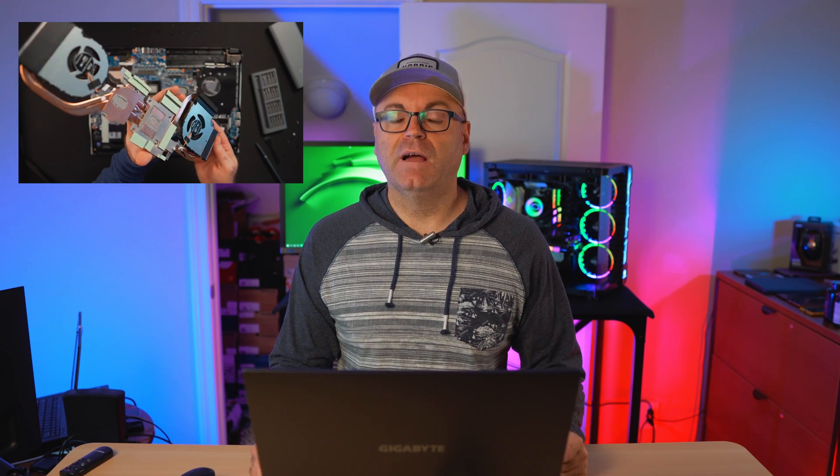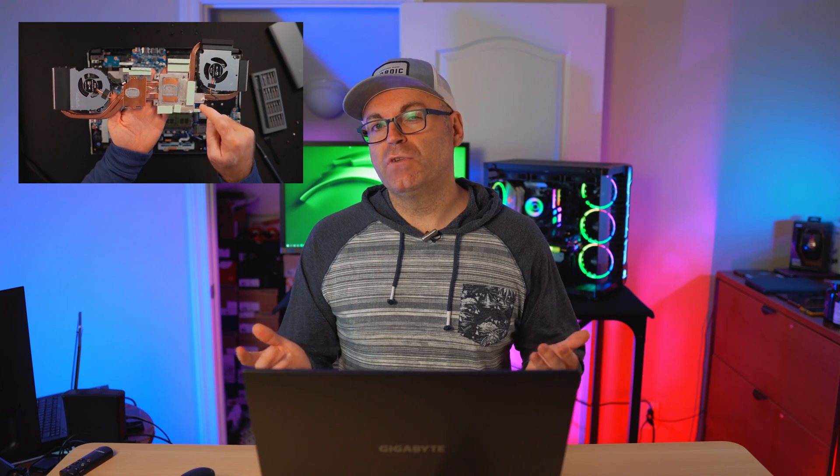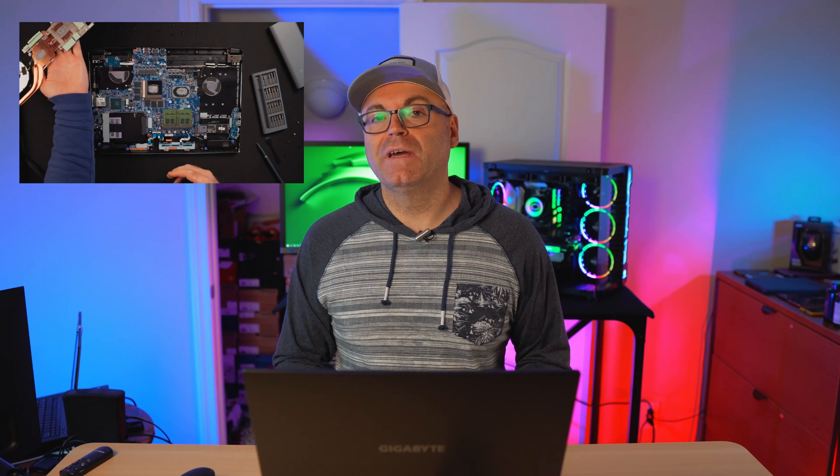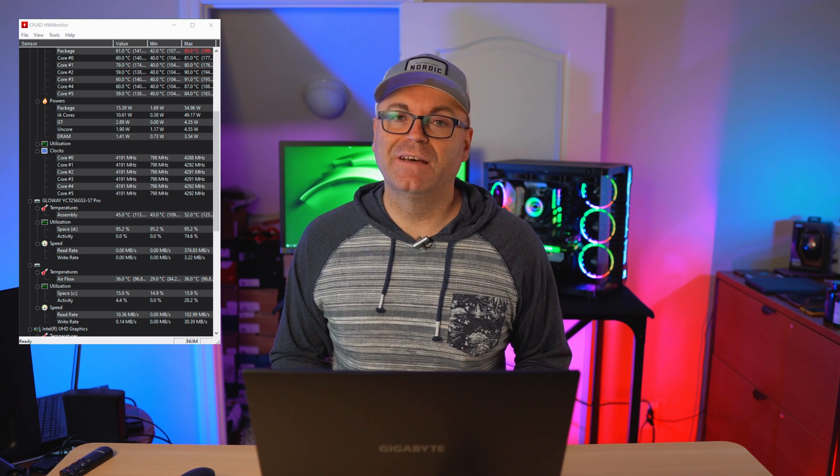That results in the CPU being very hot and running thermal throttling, which we really don't want when gaming. I was impressed with the RTX 3060 being able to go all the way to 105 watts TGP, which is excellent for games, but with more power comes more heat. I already repasted the cooling solution which shaved off a couple degrees, but with undervolting I was able to get another five to six degrees down, which finally brought the processor to normal levels — no thermal throttling even in demanding games like Cyberpunk 2077.